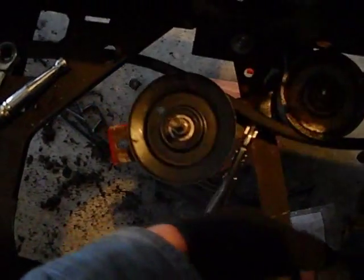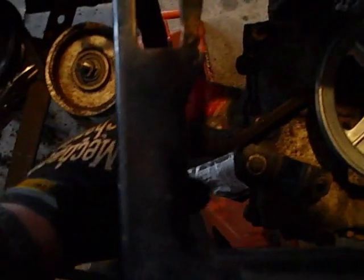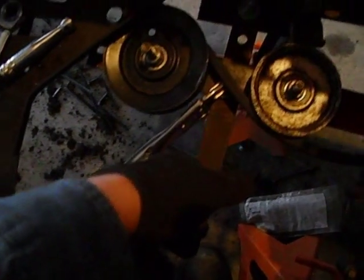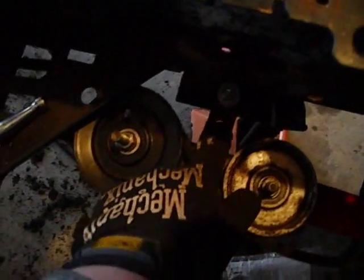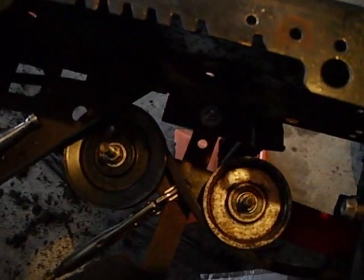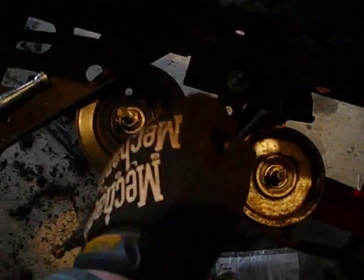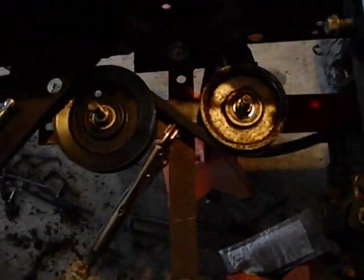I have some nice movement now, and there's still a little bit hanging on the back — I don't know if I'm going to keep that for a spring mount or not. It's still a little wobbly, and I figured out it's because of this bolt. If I put it down too tight to the point where it doesn't wobble, it's too tight to move, and when I wiggle it around it loosens up and starts to wobble again. I'll probably get a longer bolt and put more washers on so it'll allow this to move. It works really well.